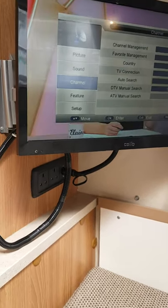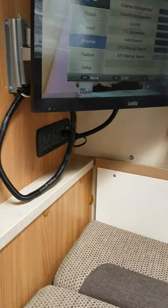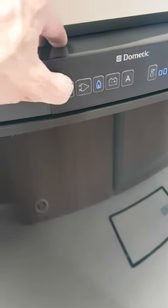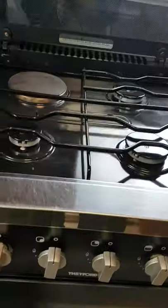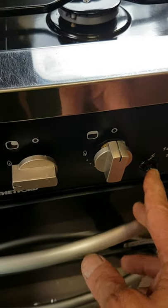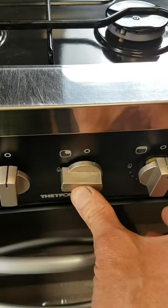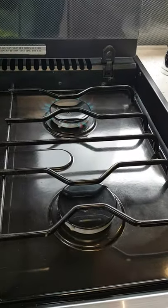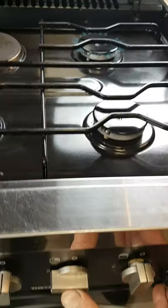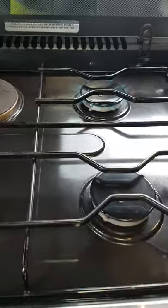Your fridge is running on gas now. If the gas wasn't lighting fully, hold in this button for a couple of seconds to power it off and try again. For your cooker — it's a standard gas cooker. Turn on one of the rings and there's a sparker button on the right-hand side. Hold in the gas ring and it will light. Once it's lit you can let go of the sparker button, and after a couple of seconds let go of the gas valve. You can turn it down, up to full, and all the way up for off.